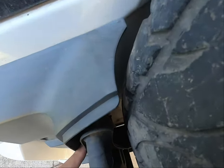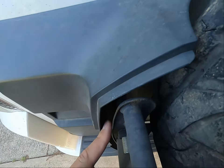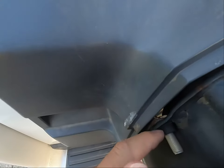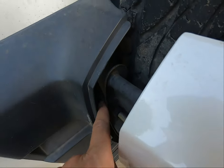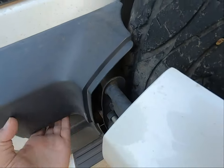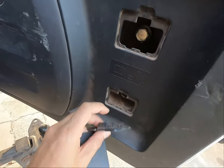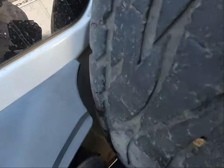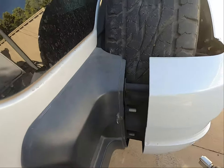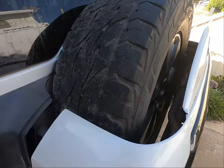On the other side I made another bracket, which you can just see down there — essentially the same sort of bracket. I cut and welded those up to fit on the other side. Now I've got bolts that go into the bracket, which go through what were originally the nut holes for the covers from the inside. Those original bolts now go into the other side of the bracket I've made, which has spaced it out and allowed the wheel to sit up high while still being able to close the spare wheel cover.